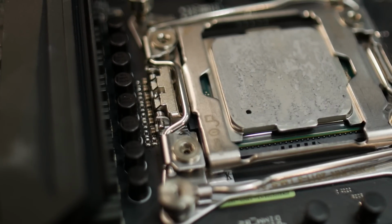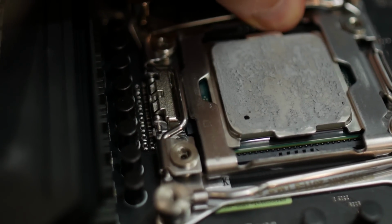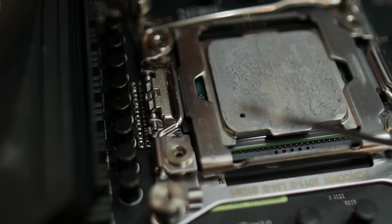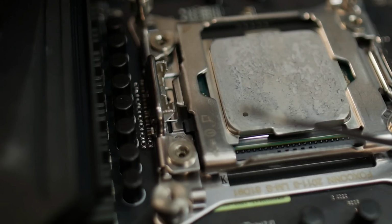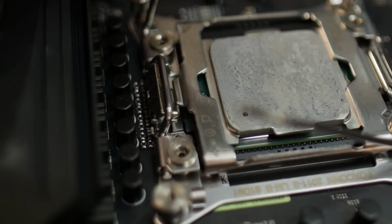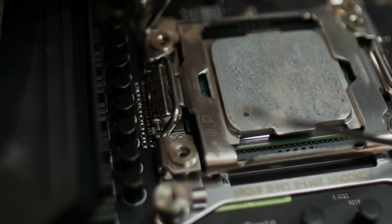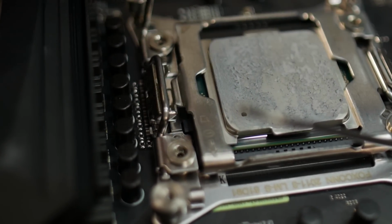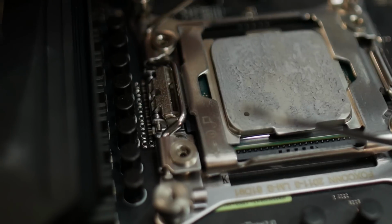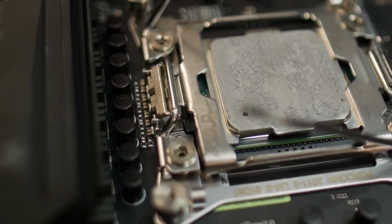Now the desktop parts, honestly, the i7 CPUs for the most part will be in general a better deal, except for the Extreme Edition part. The Extreme Edition part is like $1,700. Good Lord. Hopefully the price will drop on that. But the i7 6800, one of the non-extreme parts will basically be okay. I mean, the 6800K is a 3.4 gigahertz base with a turbo of up to 3.8. It's pretty easy to overclock, hitting 4 gigahertz with the 6800K, not really a big deal.